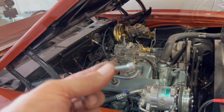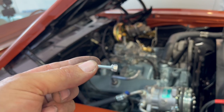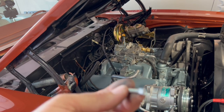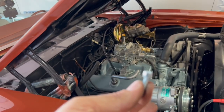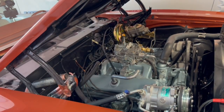Ready to mount this thing up. Look at these bolts — they have a special knurled washer on the back side that helps ensure they dig in and ground it. These bolts typically break off when you take it apart, but you can get them from Ames pretty inexpensively — you'll probably spend more on shipping than the actual bolts. These are the three bolts — we'll go ahead and mount it up on the firewall.